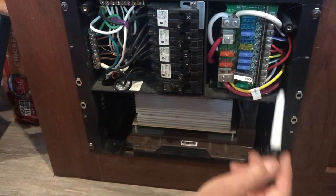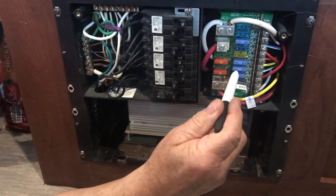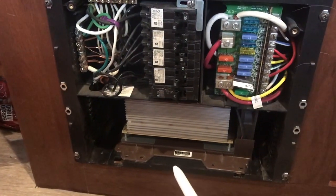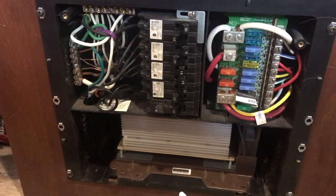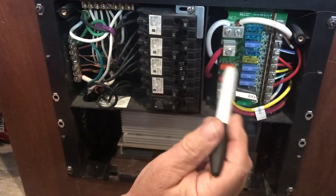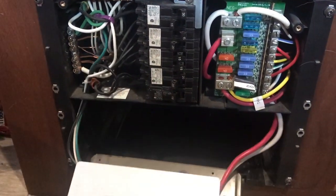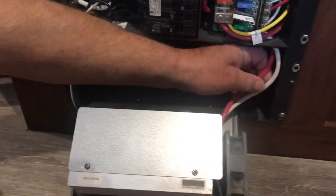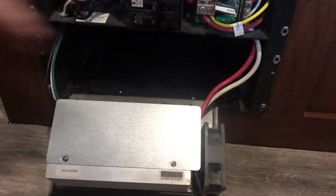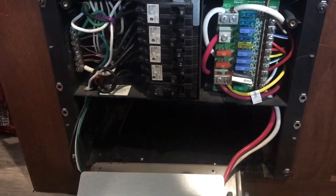This is what they call a converter. What it does is take 120 volts and convert it to 12 volts. A lot of people think this is all tied together, but it's not. All there is is this battery converter — you take 120 volts in here and it puts 12 volts out to the battery. This is why you could run it without a battery, because these wires go right here to the panel, not to the battery.